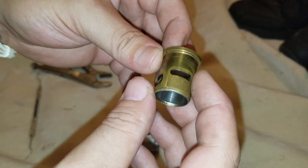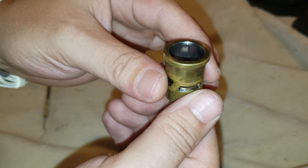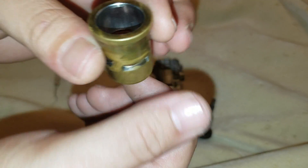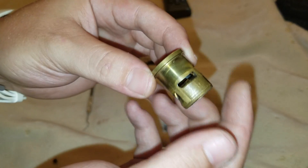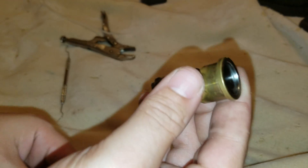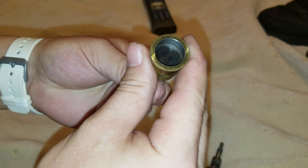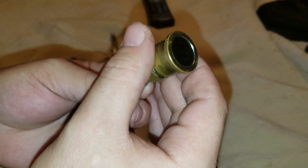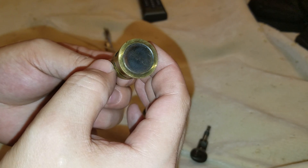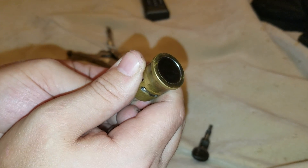The last thing I'm going to go over is ABC construction: aluminum piston, brass sleeve chrome-plated on the inside. Some motors like OS have a bimetallic sleeve. These expand and contract, and the one thing I always talk about — when you have it at bottom dead center when you're done running it — this sleeve is going to contract when it's cooling down. If you have the piston up at top dead center, the brass is going to contract more than the aluminum, and the aluminum is going to basically get in the way of the contraction of the brass. So you're going to lose compression and over time you're going to have to replace the sleeve.